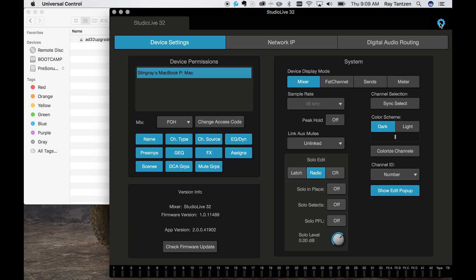Be sure your computer is connected to your mixer. We recommend using a network connection as this will be the fastest way to update the mixer — you can do it with a USB connection but it will be much slower. With UC Surface connected to the mixer, simply drag the file and drop it in the firmware update section of the UC Surface window. When the update is complete, your mixer will automatically reboot itself. You can then check the firmware screen to verify the firmware version number.